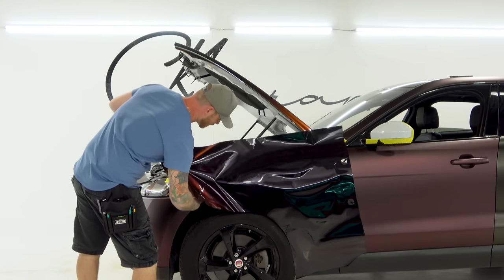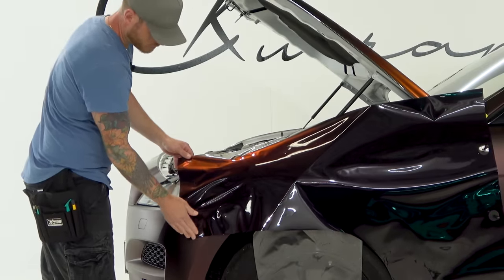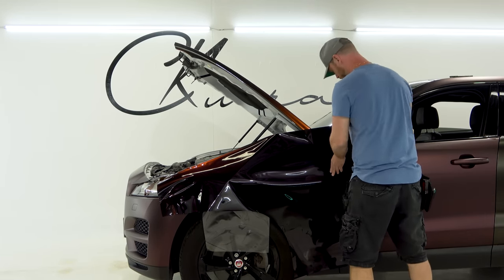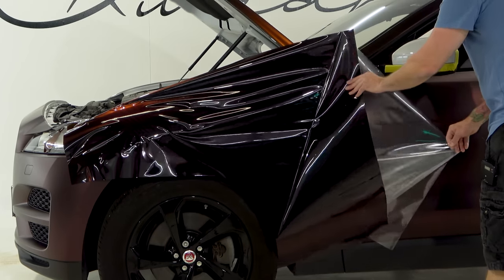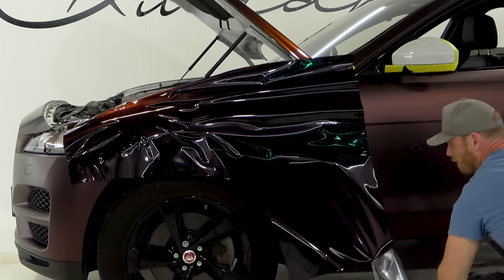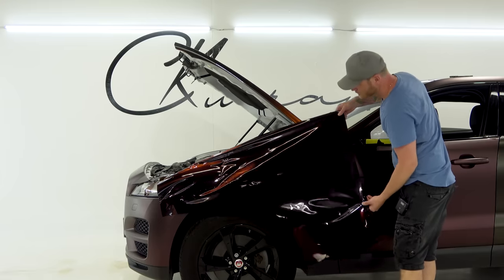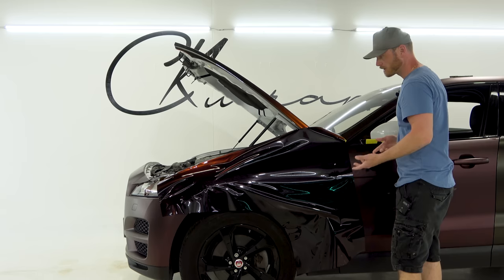The difficulty of this is not necessarily on the easy side, but you can do it if you follow this process. We're going to tack the bumper — if your bumper is still on. If not, tack it to the headlight or brackets inside. If your car is magnetic, just use magnets. There's still lots of static — I can feel it moving the hair on my arms. Roll that liner off really nicely and come right down the bottom. The tack is super nice — a low enough tack means when you move the film you don't end up with lift lines and glue lines. Super important.